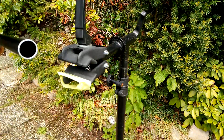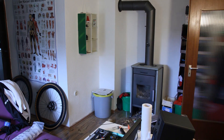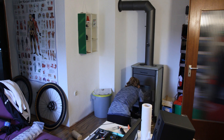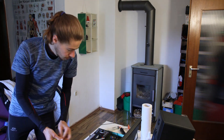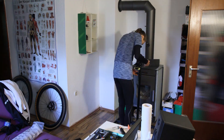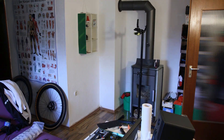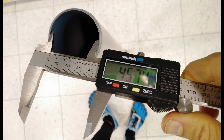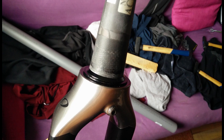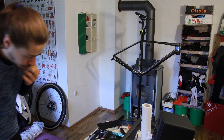One of the few things I accomplished before formally starting the build was installing the crown race — the metal shim that creates the contact point between the fork crown and the bottom headset bearing. I found a conveniently sized PVC pipe at my local hardware store with 50mm outer and 46mm inner diameter, so all it took was €1.50 and a good chunk of hammering until the crown race sat perfectly flush with the fork crown.